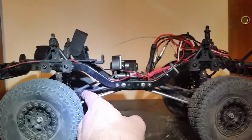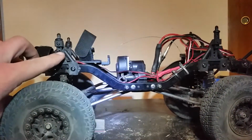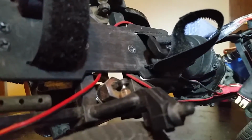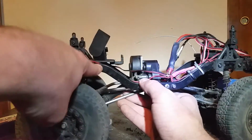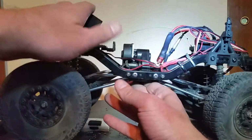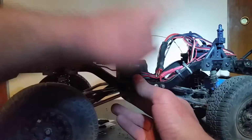And then you'll be thankful if you watched my video, because the next thing that got me wondering what it was binding on was not easy to see at all, because usually you have a body on your truck. Your posts all will need to be cut, because this guy will get right up in your body. And not only will it do that, but if you see how close I am already, it's another reason for raising your truck. Otherwise, you'll be hitting your posts and you'll be digging into your frame. The rear is freed up of all of the frame. The front is not. It rubs on some of this. I see it in the dirt. I don't ever hear the tire rubbing, and I don't ever notice it rubbing or stopping me from driving. I just noticed that it does mark it up or leave mud on it and knocks the dirt off of it.